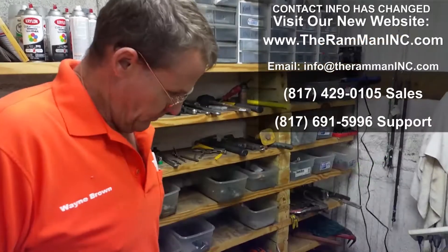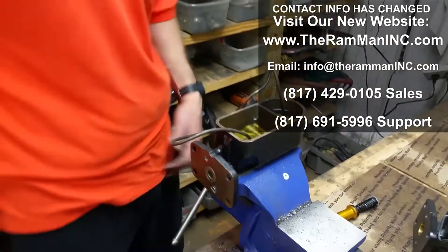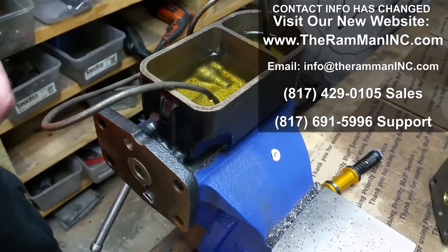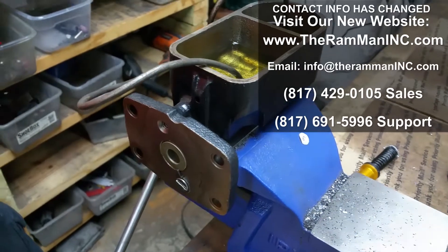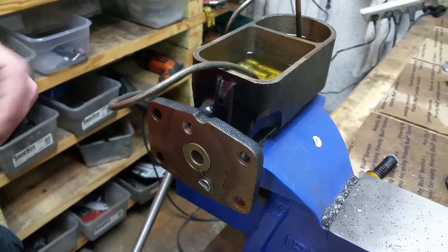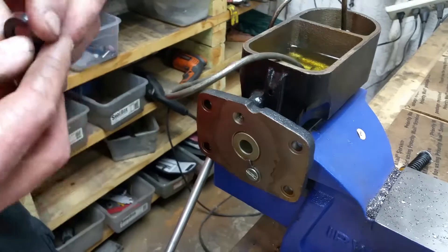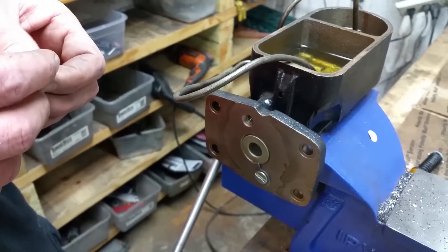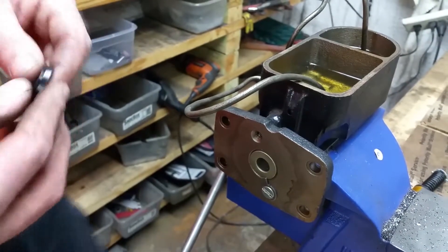This is our master cylinder, part number 222-9171. It never leaked at rest, but it did leak under pressure when we moved the piston. Just like in pneumatics or hydraulics, sometimes you can get a damaged seal that you won't be able to see — it only opens up under pressure. We allowed this thing to sit for two weeks, and lo and behold...